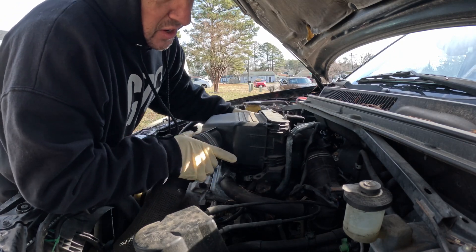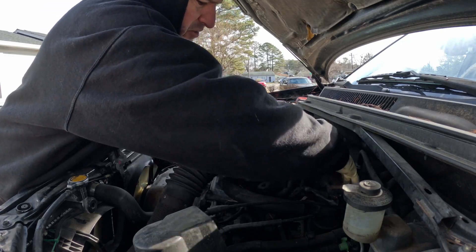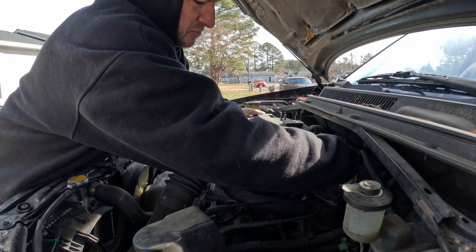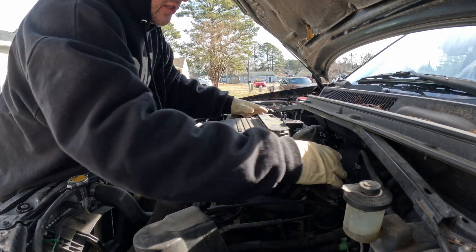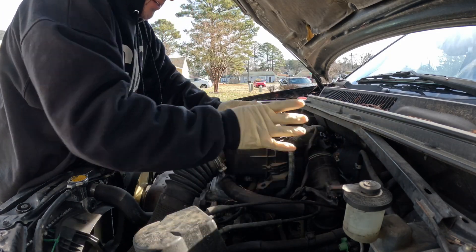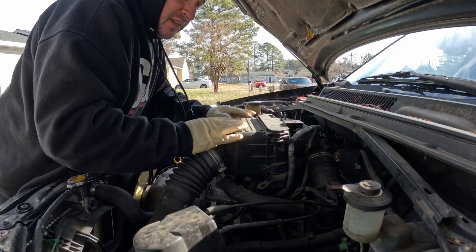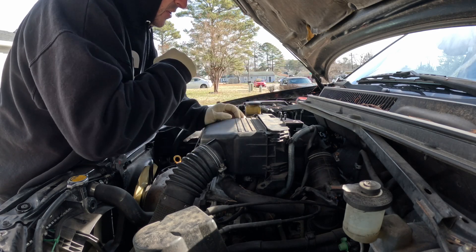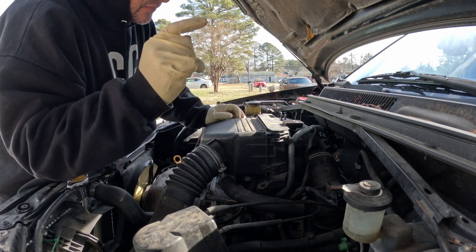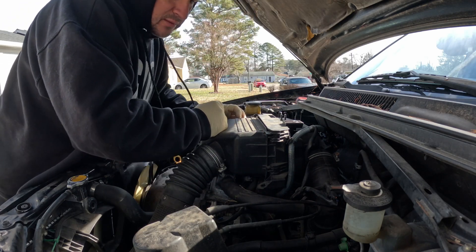You just got to put it back on the intake hose — you don't have to zip it all back down — because we just don't want to throw any kind of mass airflow sensor codes. So just set it on here so we can go ahead and start this thing back up and see if number 3, or actually number 2, is actually misfiring, since number 3 is on number 2. Does that make sense?